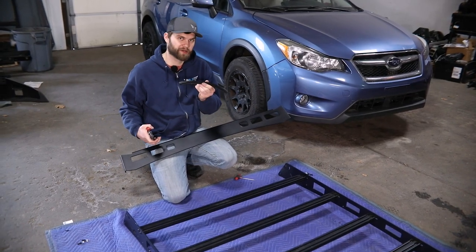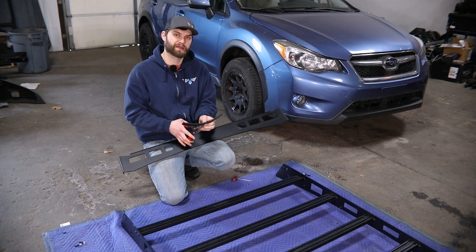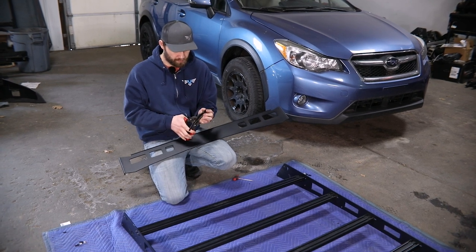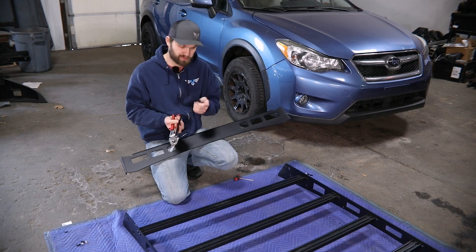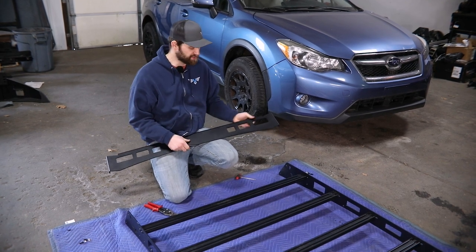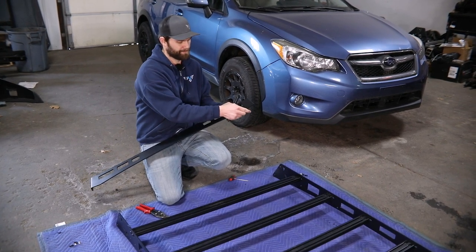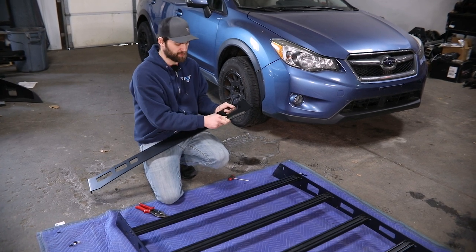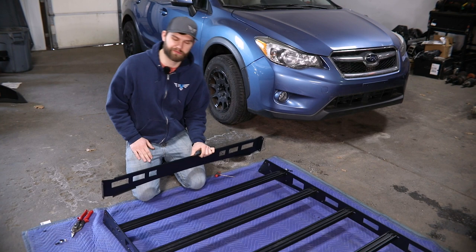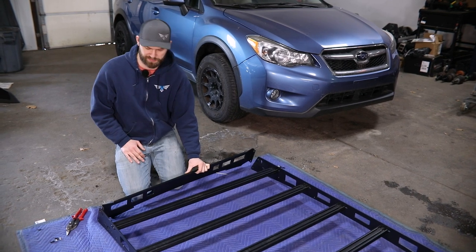Now working on your rear fairing, you'll want to take that piece of edge trim you have left over from the front and simply cut it in half. Again, check for any of that aluminum structure that you might need to get out of the way. Then take each of these pieces and go out toward the end of each point on this radius end and push that right up in place. Once you have that done, with this radius edge facing down, install this to the rack just like you did the front using that quarter-inch hardware and the serrated flange nuts. Again, slide it up as high as possible in the slot and snug it down.